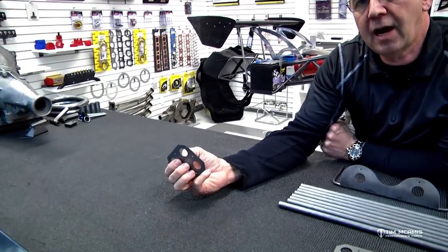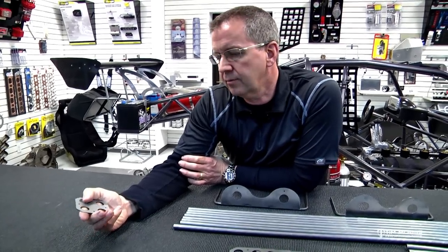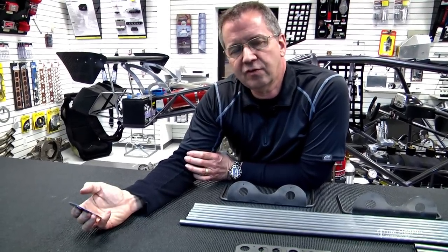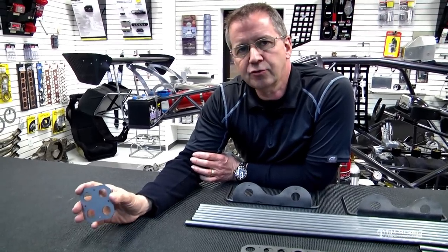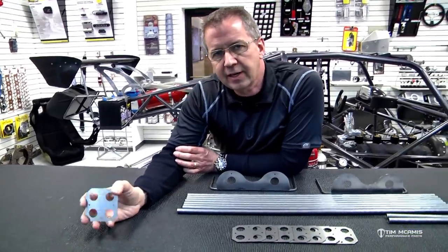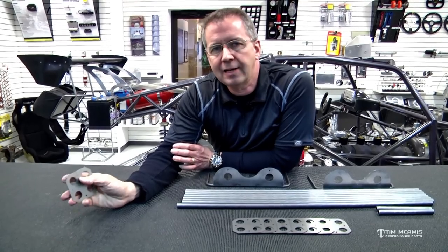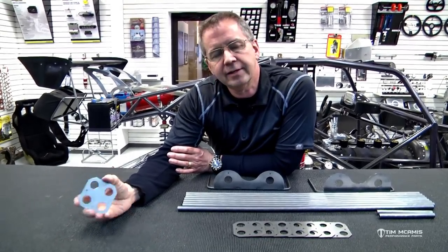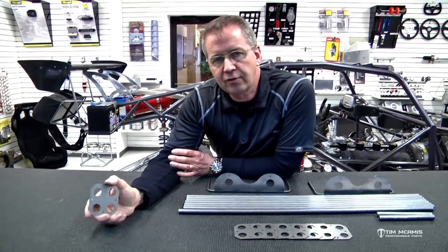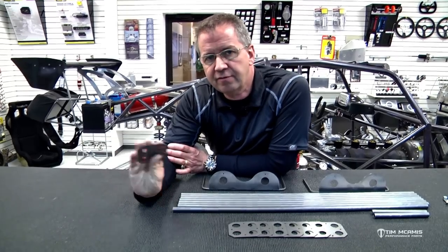That would get the body very hot right there, and especially on these thin carbon bodies, you'll see a little bit of distortion in the outer gel coat and resin area of the body. What happens is when you take it to paint, that gets fixed, gets repaired over, but inevitably it shows back up — it always shows back up. Once the car is done and you get it out in the sun and run it a little bit, paint starts shrinking, the heat from being outside starts changing the shape of the body, and I started seeing these holes showing back up and a little bit of distortion right around there. It was just a very slight imperfection, but I didn't like it, so I told my guys: no more holes in the body, we're not drilling any holes in the body, we're not doing anything to manipulate the outside of the body so that when we send it to paint we have a nice cherry finish of gel coat to deal with.